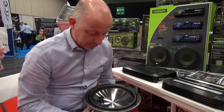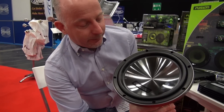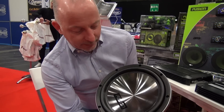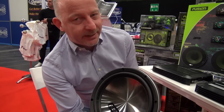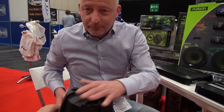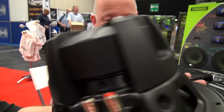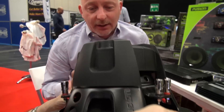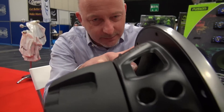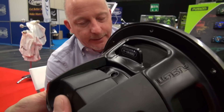Check out these new performance subwoofers. We changed a lot on the woofers — the most important part we changed is the surround. We changed this to a butyl rubber surround to make sure you can enjoy your subwoofer for many years. The woofers also changed to dual voice coil, available in dual 2-ohm and dual 4-ohm. It's a paper cone — you can see it if you look in here. Paper cone still is used for the best sound quality.